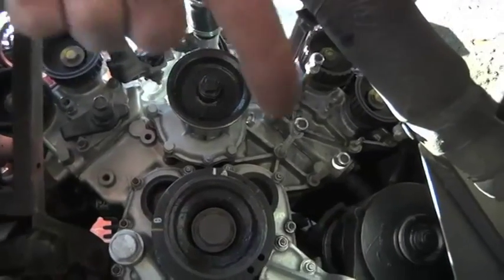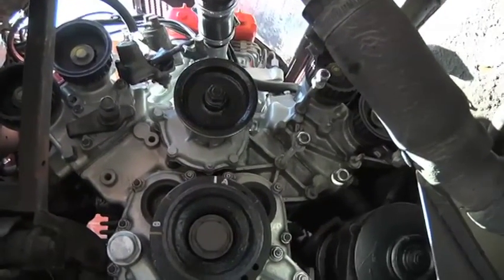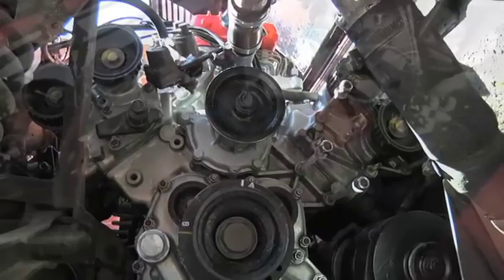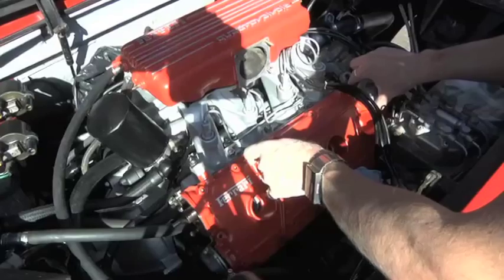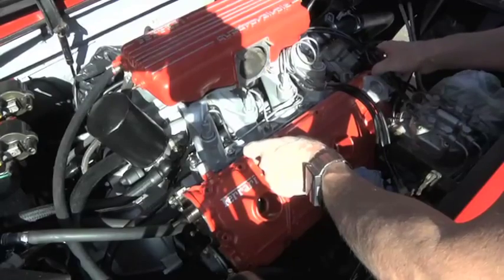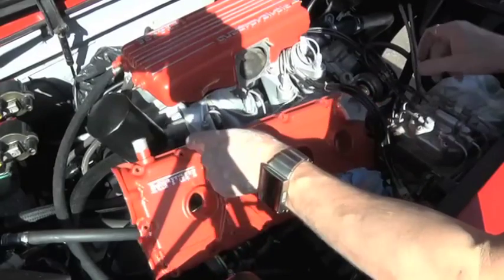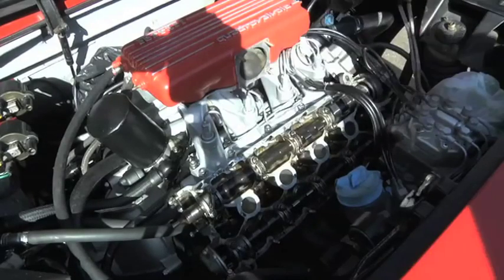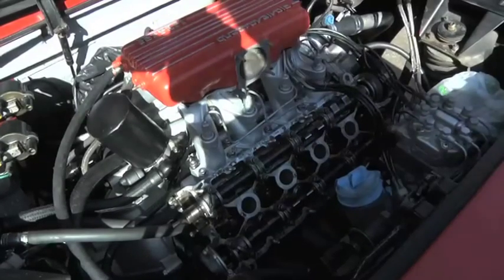Both belts are off. I've also taken off the little tensioner, which is going to be filled with grease - I'll take that off eventually and service both. The next thing is to remove the camshafts because I'm doing the oil seals on the camshafts. I'm going to remove the exhaust camshaft and measure the shims. The trick is to remove all of the caps evenly, don't mix the caps up, and don't get them the wrong way around - they are numbered.